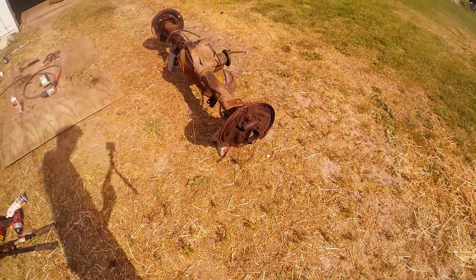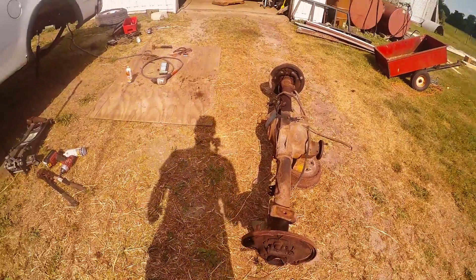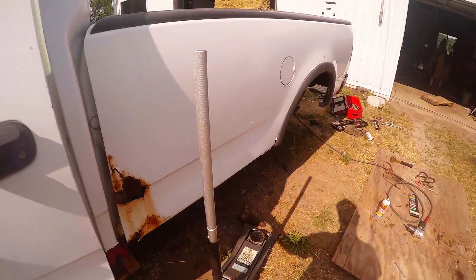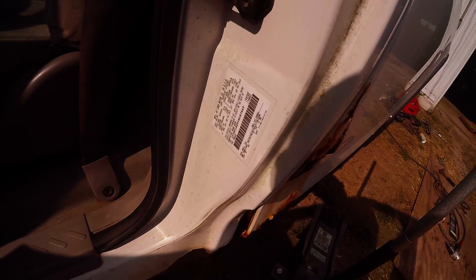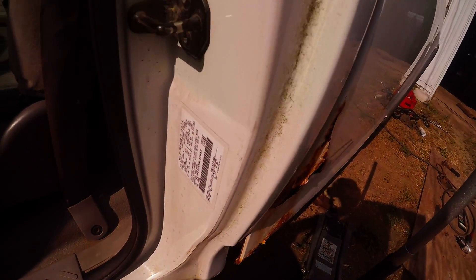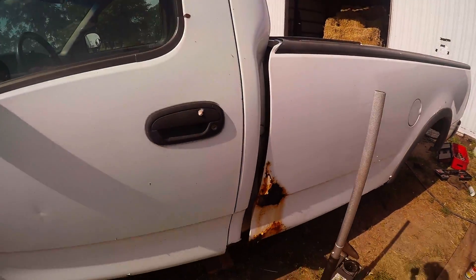But you got to make sure you get the right one, because it's four wheel drive. You can't have an axle in the back not spinning as fast as the one in the front. The easiest way to do that usually is to check the axle code on the door — there's a little sticker right here. Axle 19. So I already know it's a 3.55 rear end.